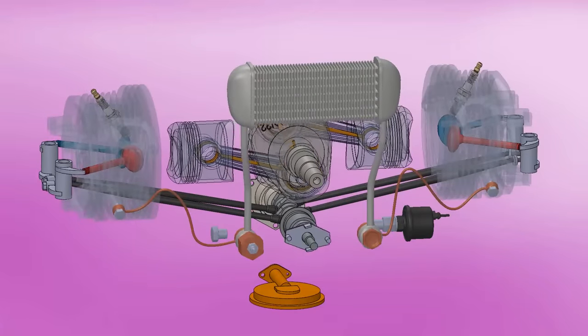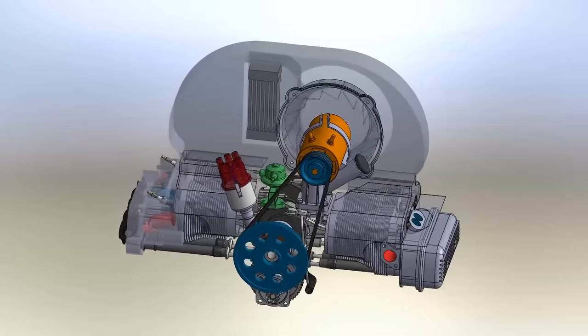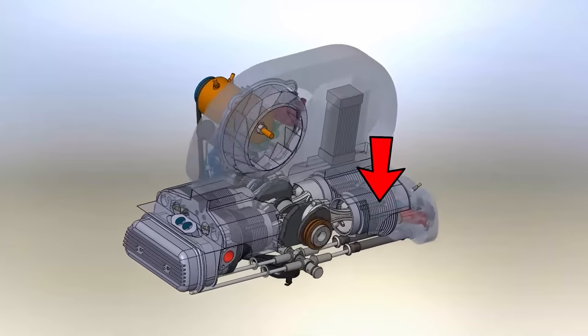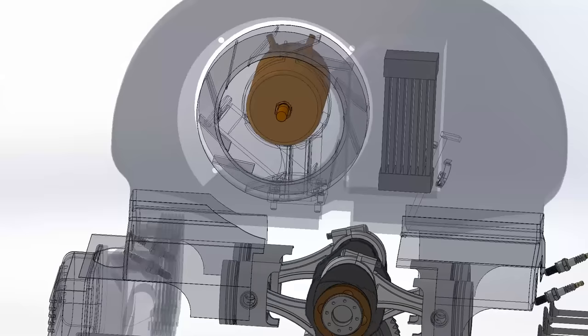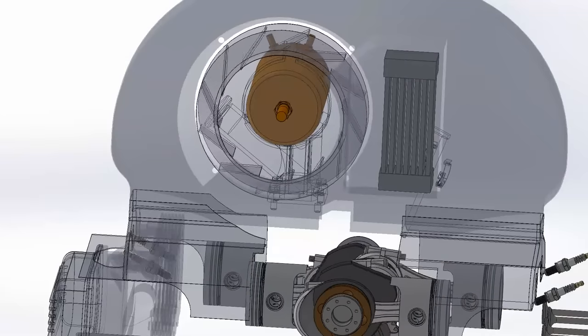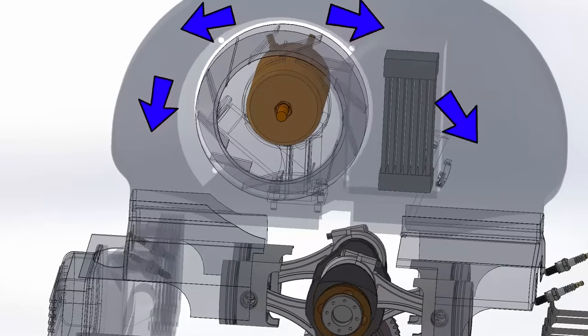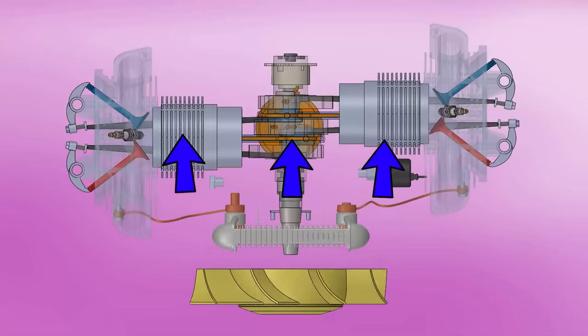The aluminum oil cooler is located just behind the fan and doesn't clog other cylinders like it does on the Beetle, which has cylinder number three with the spark timing slightly delayed to compensate for extra heat and possibility of knocking. Additionally, the Beetle has a centrifugal fan attached to a large duct that directs air into the cylinders, causing the air to change direction, increasing resistance and decreasing efficiency. The axial fan on the 2CV pushes straight through.